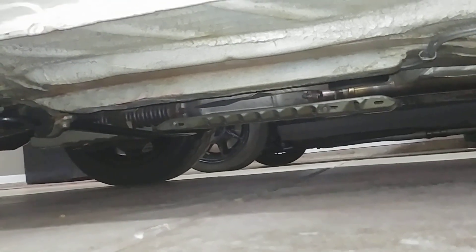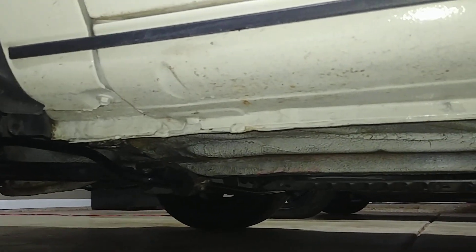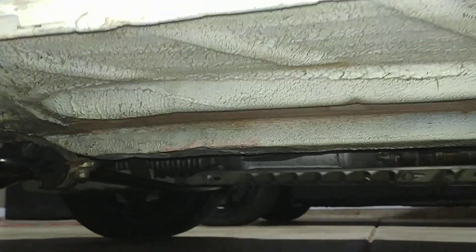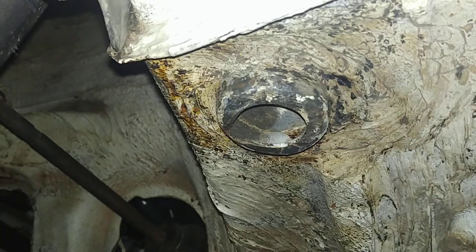A lot of times these beams are really flat, and that's true of the pinch rails too — a lot of times these are completely crushed flat. So this car doesn't have a perfect jacking history, but actually pretty good. If you're not going to do all the work on this car yourself, I think it would be prudent to add some labeling: not to lift by the beam and not to lift by the pinch rails, but to lift by the correct jacking pad. Which is really obvious, but for some reason is frequently overlooked.